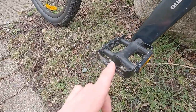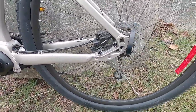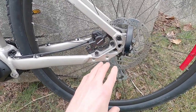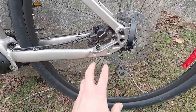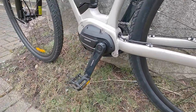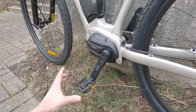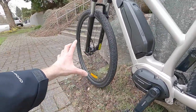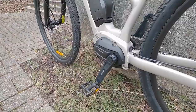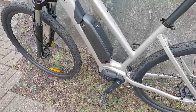This is steel and you can see that it's already starting to rust just a little bit — this is a demo bike. And it doesn't have a kickstand. The bike doesn't ship with a kickstand, which is a little bit of a bummer. I think this is a 40 millimeter spacing so you can mount one aftermarket. It's tucked in so hopefully you're not gonna kick it, but I was sort of disappointed that it doesn't come with a kickstand. Back to the 175 millimeter crank arms — it's a little bit longer than average. 170 is what I usually see, but with the taller wheels and multiple frame sizes, perhaps they have different crank arm lengths depending on the frame. The pedals are fairly easy and cheap to swap out and upgrade.